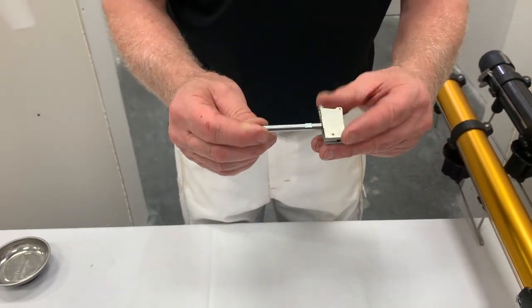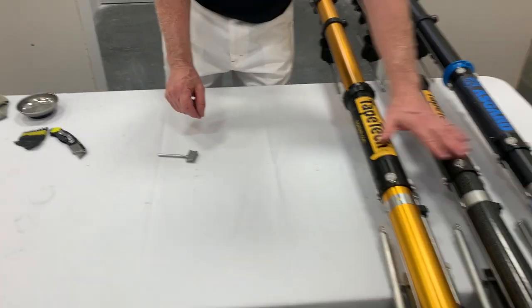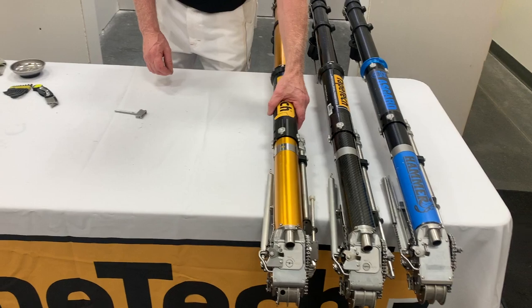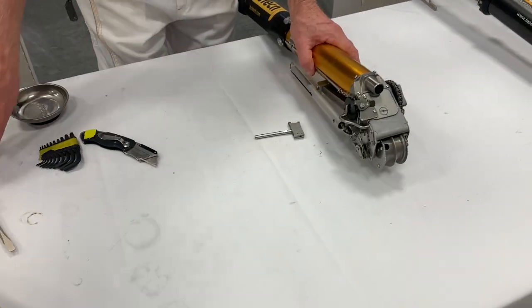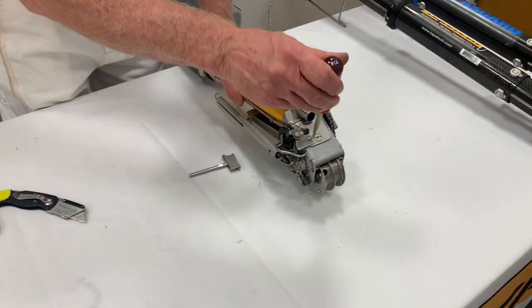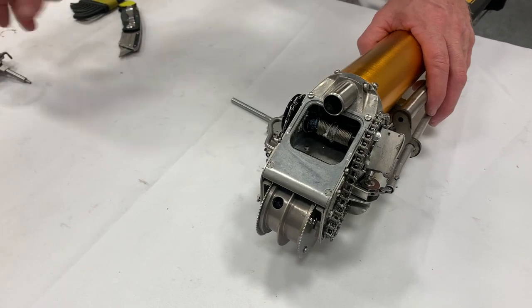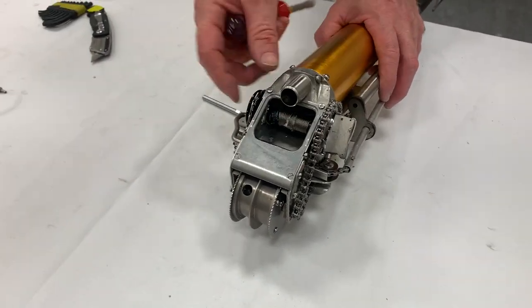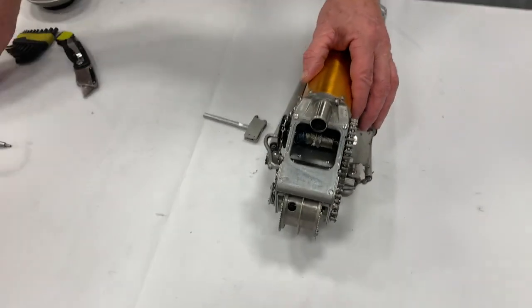We need to be aware of where that flat spot is when we attach it to the tool. We have the Tape Tech standard aluminum, carbon fiber, and Asgard hammer. First, using a large flat-tip screwdriver, remove the easy clean plate. For an Asgard tool, you'd remove the whole plate — the two front screws, loosen the two sides and back, then pull the whole plate off.